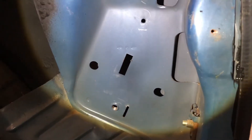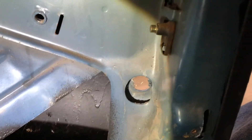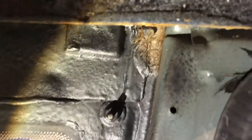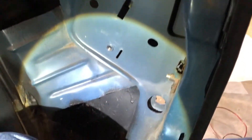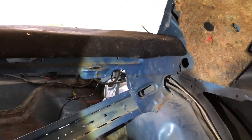All my seatbelts in the front are missing, so we'll have to figure out some seatbelts — there's a little hole that goes into the door jamb that makes contact with the door, and the retractor would be right there coming up the B pillar — that's where the shoulder piece would bolt to. A little bit of detective work goes a long way. You can kind of see the edge of the headliner — that blue is peeking through — so somebody covered the blue headliner with this velour, maybe blacking all this out. If they would have only known how rare this blue interior really is, maybe they wouldn't have done it, but it is what it is.